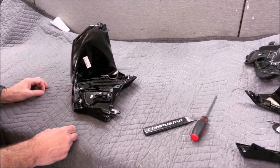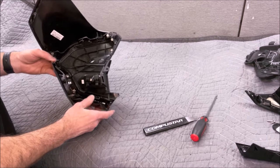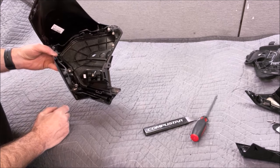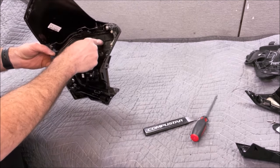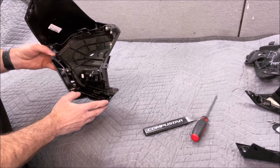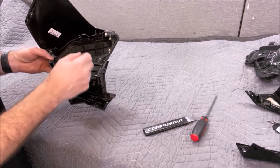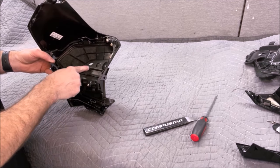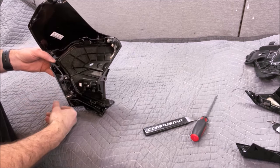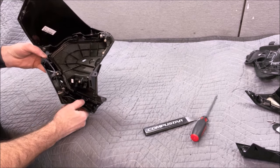This is Mike with Motorrad Audio showing how to do the grill modification when installing the six and a half inch pods. This isn't required, but the opening is not very large since it's designed for the small factory speaker. It definitely helps if you open up some of these channels. You'll want to do that with a Dremel or a drill — a step bit works well. You'll want to leave these ribs in place because the fabric is basically held on by this structure — you don't want it drooping down later as heat softens the adhesive over time.